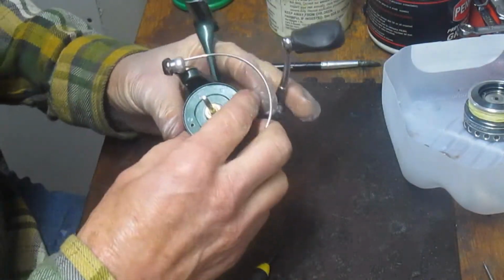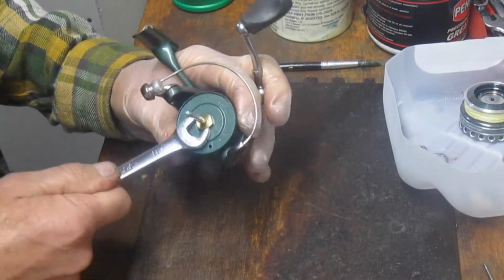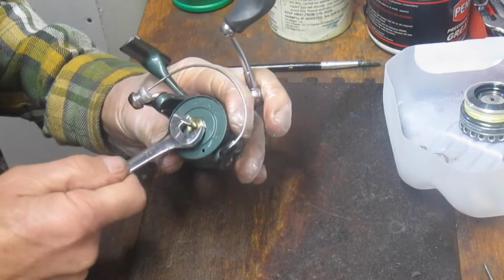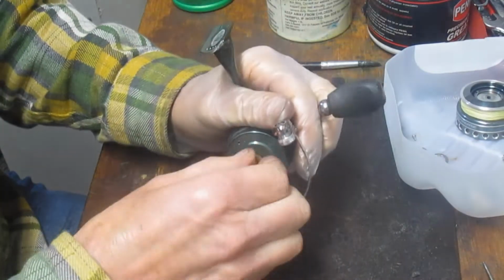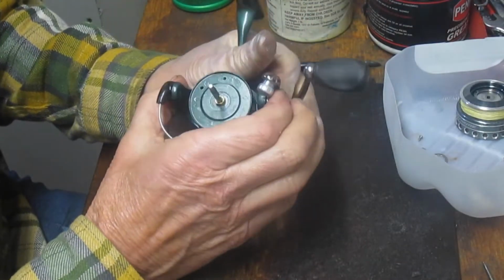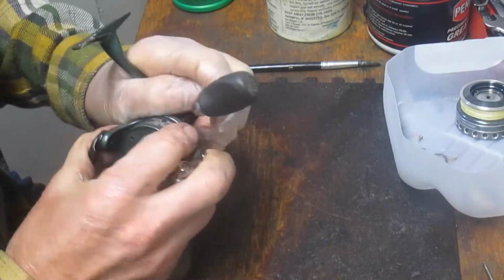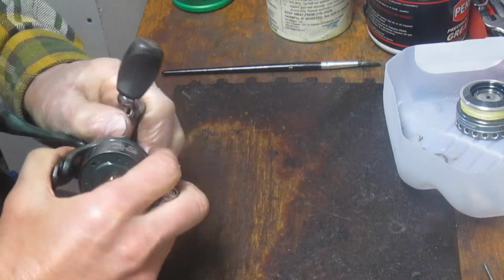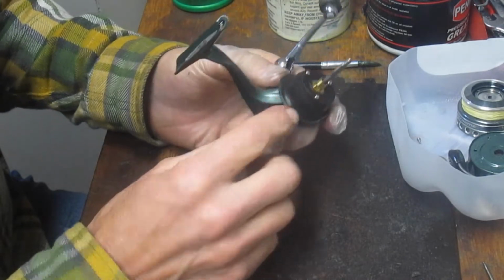And then we can get to the nut that's holding the rotor down. This one looks like an 11 size maybe. This is a metric 11 if you're playing along and trying to get that done. There you go. All right. And this one comes off in the traditional left counterclockwise threading. And I'm going to pull the rotor off. Also easier said than done. There we go.